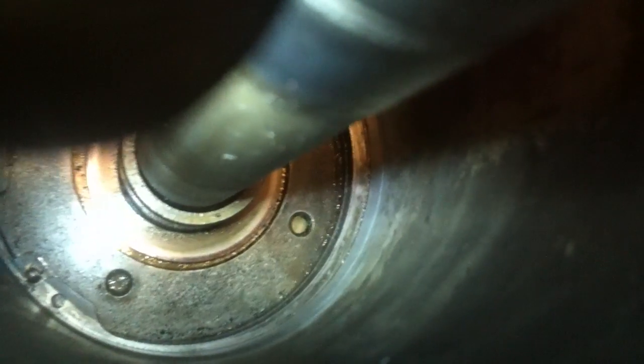Here's what it looks like with no bearing carrier. You can see down in there — there's that surface right above the snap ring. Clean that up because someone nicked it when they put the snap ring in, so the o-ring wasn't sealing good. You're supposed to have a piece of threaded rod to stick in these holes so you can line it up when you put it back together, but I don't have one so I'm going to use a piece of aluminum rod just to line it up.